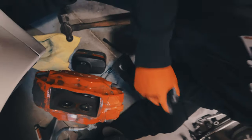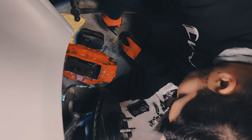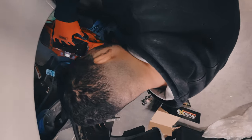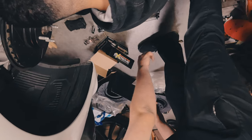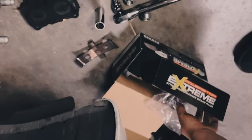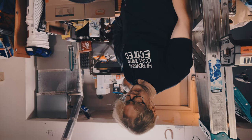Do the new brake pads come with pins? Yes. No, not pins. The shields for the back. I don't know. These pistons are pretty compressed, so I don't see why. So to clarify, those pins can get worn, and Tesla recommends that you do them every time you do a service on the car. Well, I'm not going to put them on yet. I want to put the caliper back on. The brake pads came with replacement pins, those two pins, in addition to something about the back of the brake pads. The mounting, I didn't touch them.